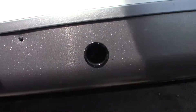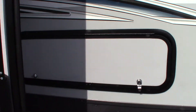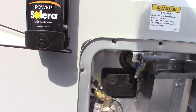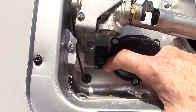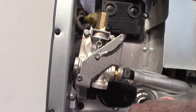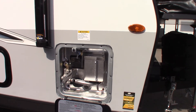This hole here tells us the slide-out can be cranked manually — there'll be a crank you can stick in there to crank the slide-out in and out in an emergency. Your water heater on the outside: I showed you the switches on the inside, but keep in mind there's one more switch right down here — a rocker switch on and off. It controls the electric heating element behind this cover. Before you can turn on the electric water heater, you have to switch this to the on position — there are two on switches. Also, never fire it up without water in the tank or you'll damage it.